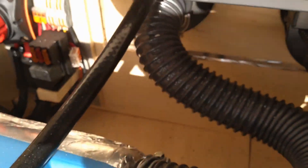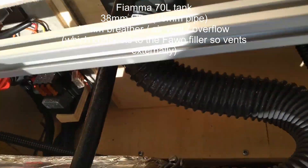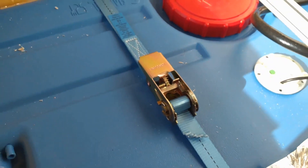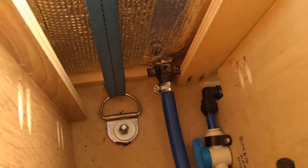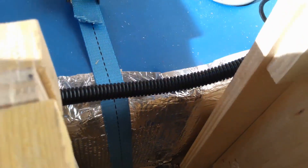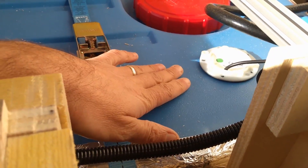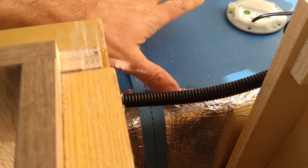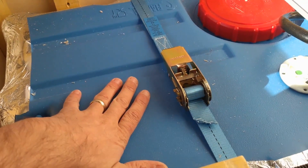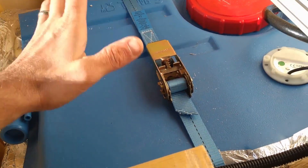Inside, this is the filler — it's got a 38-40mm inlet pipe and a 10mm vent pipe, so it all goes into the tank and air comes out the top, along with any overflow. The tank is a standard Fiamma 70 litre tank using their mounting kit, but I've also strapped it down with a ratchet strap to a load-bearing bolt with a load brace underneath, so in an accident it's not going to come out and kill us. We've insulated it just a fraction because if you put in icy cold water and the air in the van is warm, you can get condensation and damp patches around the tank. Most people would go external, but our experience of usage in winter is that it will freeze even with a heater, so we've got room and we put it inside.